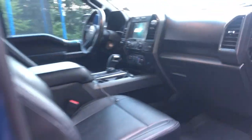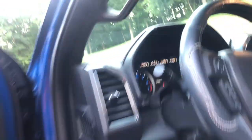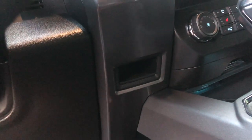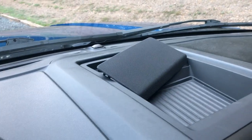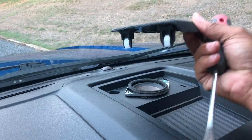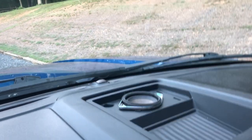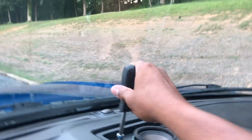So what we're going to do today is get this trailer brake controller installed. I'm not going to go through every single individual part — I'm just going to stop and go as I walk through it and let you all know what we're doing. The trailer brake controller is going to go down here, so these couple pieces of trim are going to have to come off. The first thing I did was use a panel popping tool, went underneath here, and pried up this little screen — it has four little snap pins. On the top I'm using a seven-millimeter to get those two screws out.